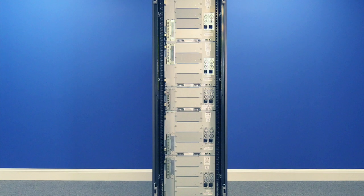Similarly, in the rear of the library, the addressing is much the same. The only difference is that it is a two-digit hardware address instead of a single digit. This is because for all rear replaceable components, there are multiple locations in each unit where the component could be. For a two-digit hardware address, the first digit is always the unit of the library that the piece of hardware is in, and the second digit is the number of the component within that unit.